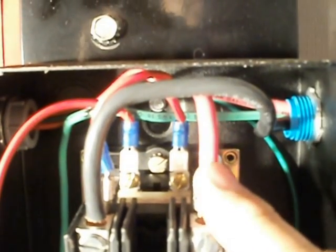Then off the other hot wire, we have another hot wire coming in — the red one right here. Off the back side of that, we have a terminal here with a wire that runs down and kind of disappears behind the starter, but ends up at one of two terminals down here on the bottom. These are the two terminals for the heating element. Off the other one of those terminals, the wire comes up, runs around, and comes up to the other terminal on the coil, making the circuit.